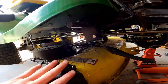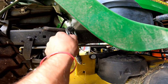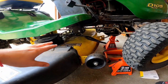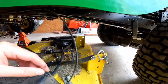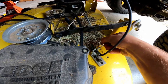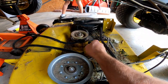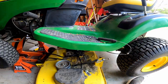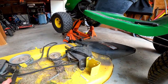So we're going to be taking the deck off — I think that's going to make it the easiest, and it's probably the right way to do it. There's a bunch of these cotter pins, so we're just going to pull them off, and that's going to drop our deck down, and then we can work on the belt. Once you get all those cotter pins out, they're just hooked up there. There's a cotter pin holding this in there, so pull that and take your spring off. Now your entire deck is free from your mower.